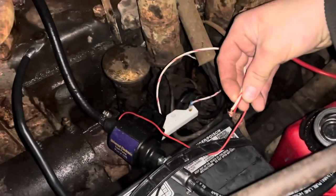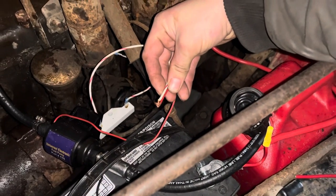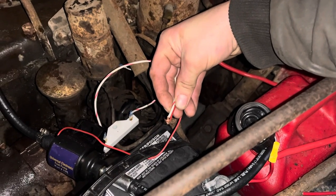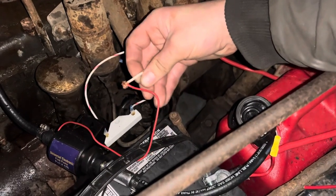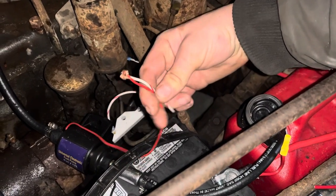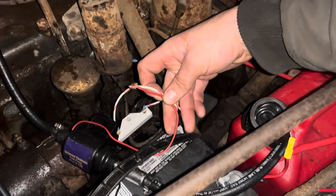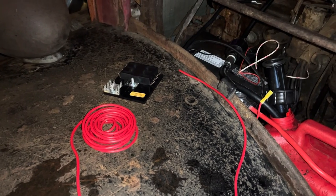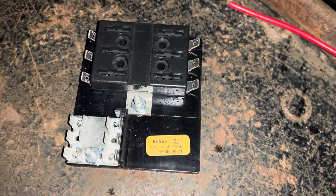In this particular case, I also added the tiny fuel pump and the tiny gas can, because I choose not to trust whatever horrible sludge is in the gas tank. I already got one truck running from the same location and the fuel that was in the tank would not even burn — it was incredible. What I have here is a hot wire going to coil positive through the ballast resistor and the positive wire for our little pump, and it's as simple as connecting those to positive. It seems highly inconvenient to have to do that every time you want to drive, and there's no charging system or lighting or anything else, so I guess the next step would be run a wire to this little bugger.